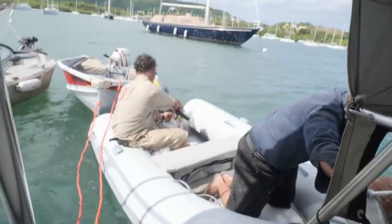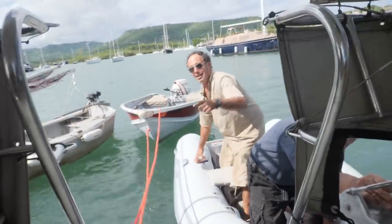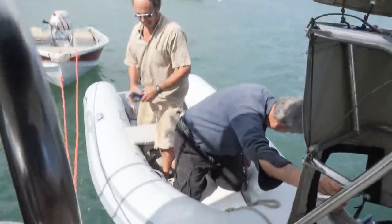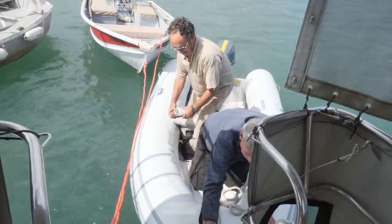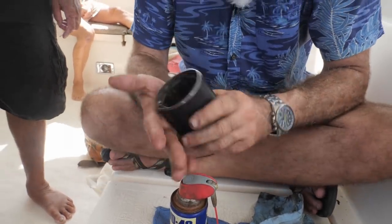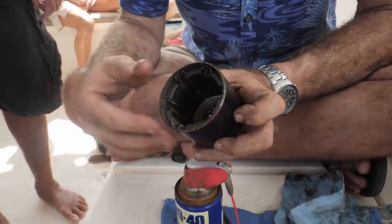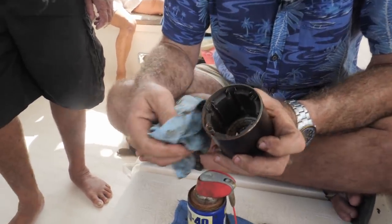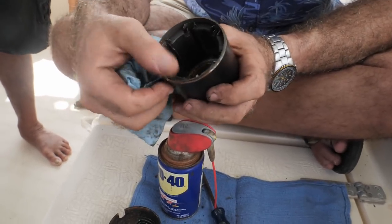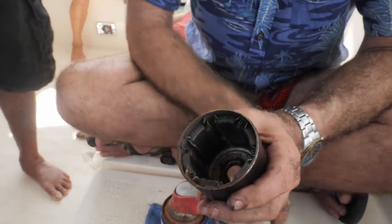Let me talk about lubes because I'm using various lotions and potions here. This is grease - a mixture of oil and soap. It's thick and it stays where you put it. You can squeeze it harder without it squishing out, so it can handle harder loads. Put it on gears and bearings under big loads. Then there's light oil, like what you'd use in a sewing machine - really slippery, makes things slide over each other. This is WD-40. Everybody uses this as oil, but this is not oil. This is a solvent - it forms a coating on things and stops corrosion, but it's mostly solvent. If you spray WD-40 on something that needs oil, it washes away all the oil, leaves a tiny bit of very light oil behind, and then three days later the thing has no oil and really goes bad.